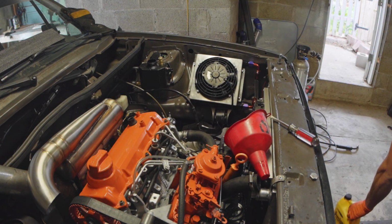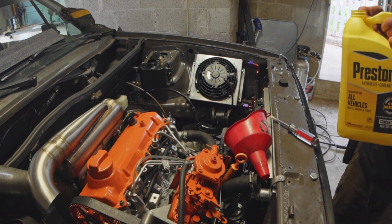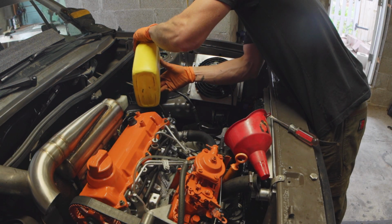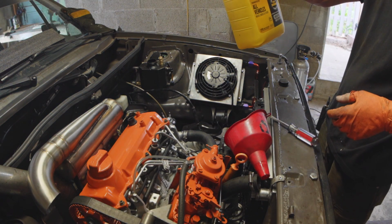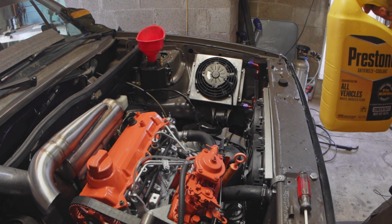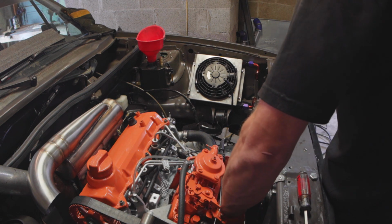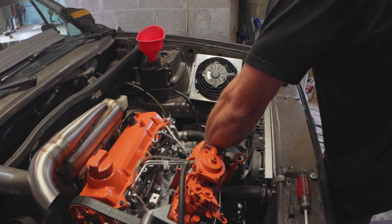I'm gonna add some water to this because I'm pretty sure it's concentrate. I usually mark when it's not. Let's just verify. Yeah, that's concentrate. You can just tell by how it pours. I mean, glycol by itself pours like syrup, and when you add water to it, it pours like water. And I find you kind of want to check your hoses on a new motor and squeeze them. And you can feel where the coolant is and where there's still just air.